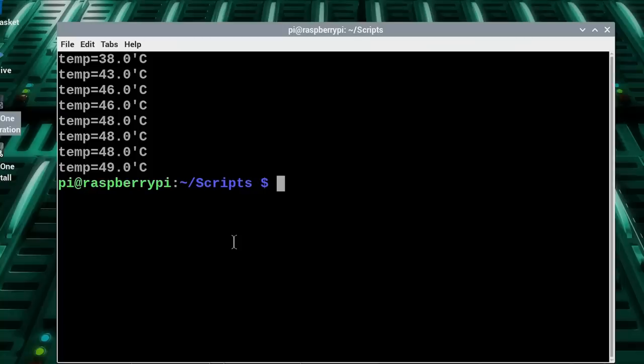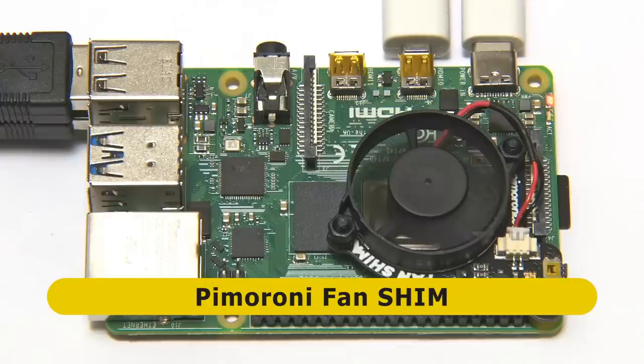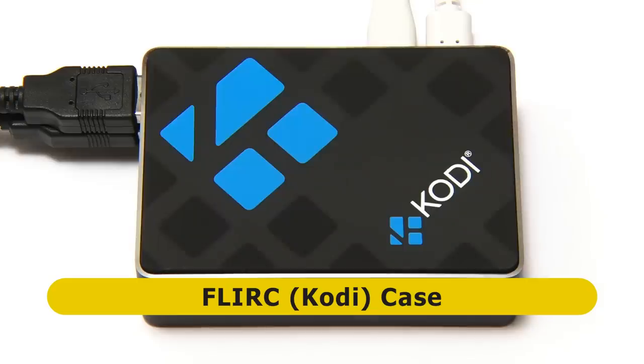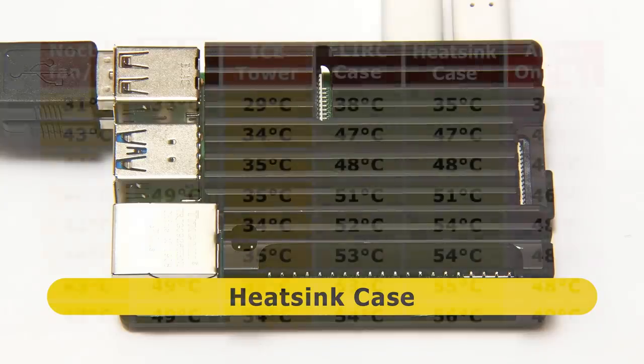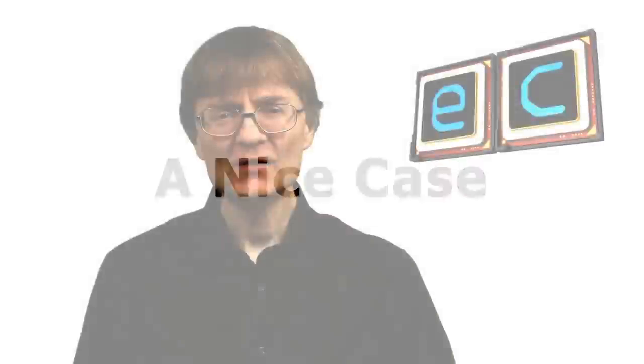Comparing to various other configurations of Raspberry Pi 4 cooling tested on the channel — including a Noctua fan and heatsink combination, a Pimoroni fan shim, the Ice Tower from my Ultimate Raspberry Pi 4 rig, the Flirc case, and a Raspberry Pi 4 heatsink case — the Argon1 comes out pretty well. It's not as impressive as an Ice Tower or the Noctua fan and heatsink combination, but it comes in third with very respectable results. The Argon1 M.2 case turns a Raspberry Pi 4 into a very stylish small form factor computer. The case does cost more than a 2GB Raspberry Pi 4, but if you want to case up your Pi with an M.2 SSD in a very nice outer shell, the Argon1 M.2 is well worth considering.